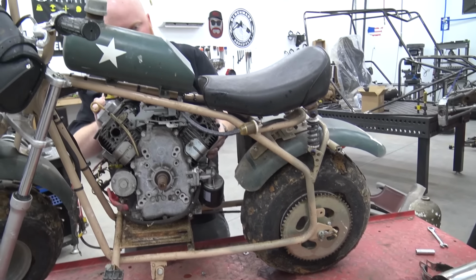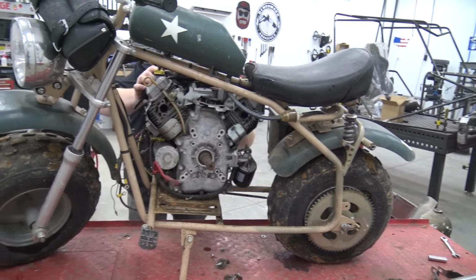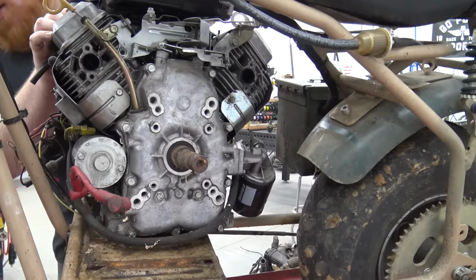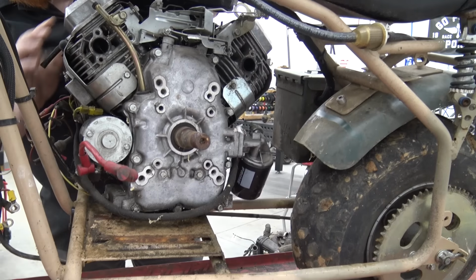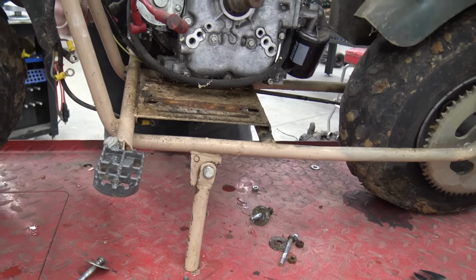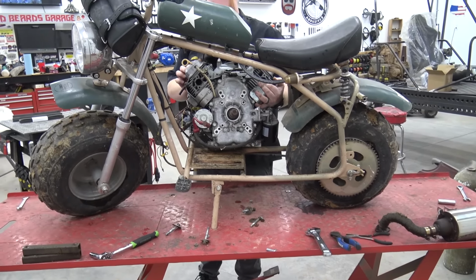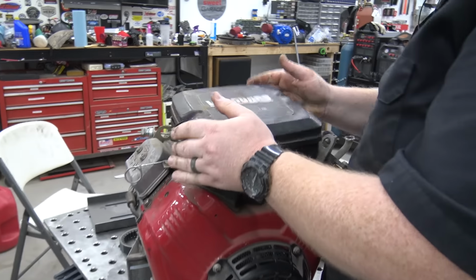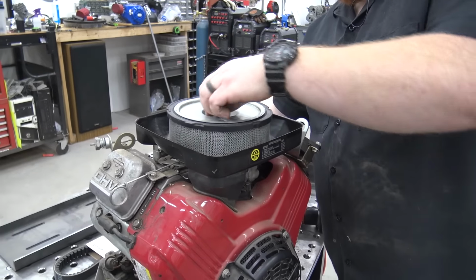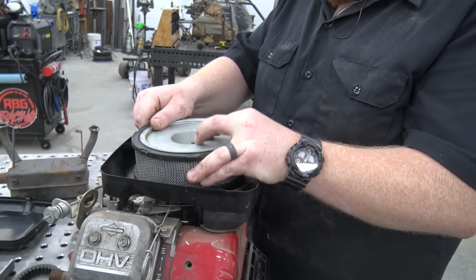The air box ain't going to fit, I don't think. No, or this throttle bracket, so we'll remove those two. Other than that, if we can drop this engine plate lower, you see how it's above it? We can make it flush in here. I think it's going to fit without the air box, so we'll pull it off. We'll have to make an adapter to put, most likely put a Mikuni on this thing. I like it, it looks like a little V8.